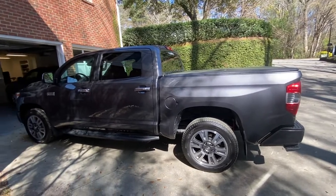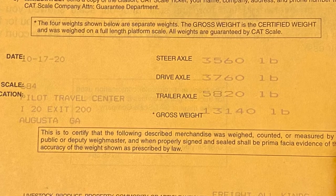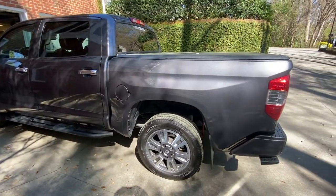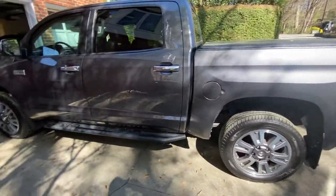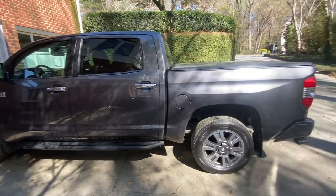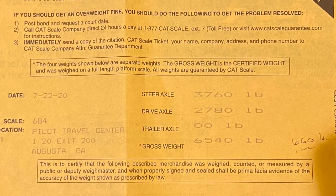A more accurate way is to load your entire vehicle with everything you'll be hauling, get a full tank of gas, and drive through a Cat scale. They'll give you a printout showing weight on your front axle, rear axle, and trailer axles — that tells you how your weight is distributed far better. My Tundra is rated at 4,150 pounds on the rear axle and 4,000 on the front. I also weigh the vehicle unladen first — that gives me my stock front axle number, and I want to restore that weight to the front axle as close as possible so the tires maintain good ground contact while traveling.